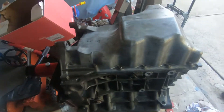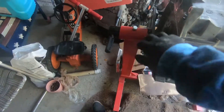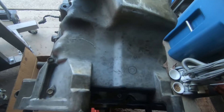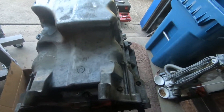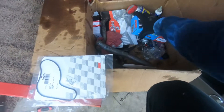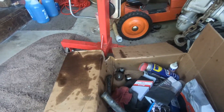The whole bottom end is together — everything is torqued down to spec. The oil pan bolts were 104 inch-pounds. Got the rear main seal on, everything's good. Now I'm going to pull the engine stand bolt out and rock the engine back and forth so the oil gets distributed down into the piston rings. Then I'll flip it over and finish up the water pump — I got a new water pump gasket because the old gasket stretched out. I also have my head studs and timing belt pulleys to go on.